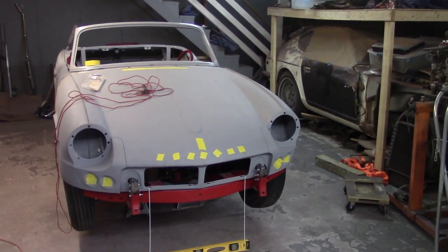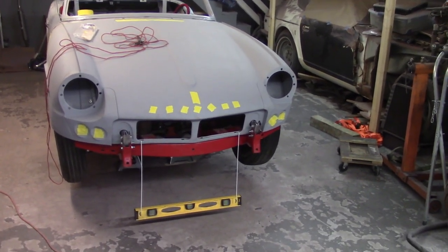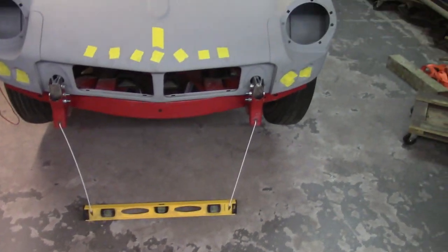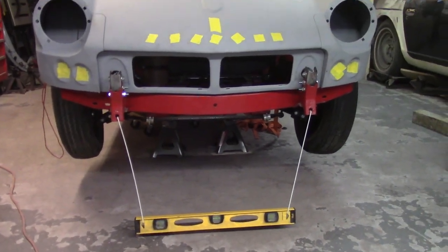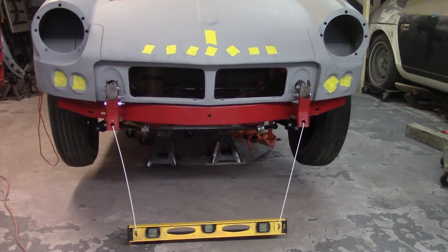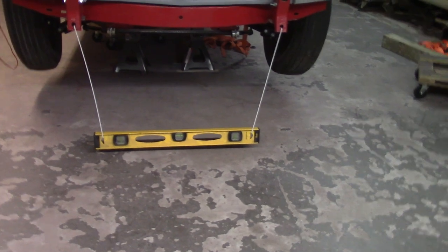You guys are probably going to think I went off the deep end here, but I've got a level hanging off the bonnet using coat hangers off of the pivot points. I removed the dollies from underneath the wheels so they wouldn't interfere, jacked the car up on jack stands, and I've got shims underneath one jack stand. My goal is to get the frame as level to the floor as I can. The coat hanger pieces are the exact same length, hanging off two identical points.